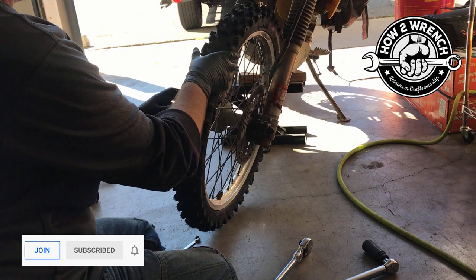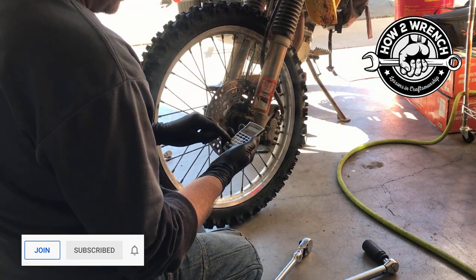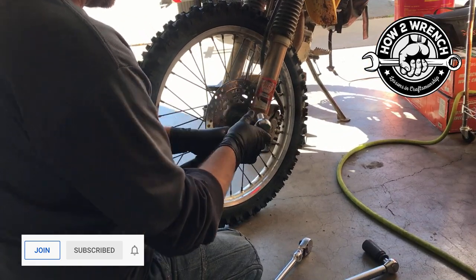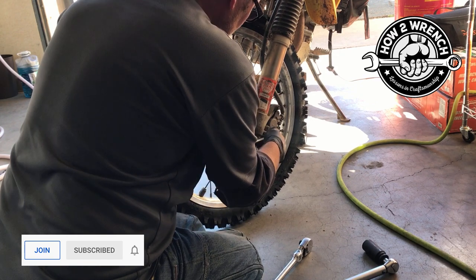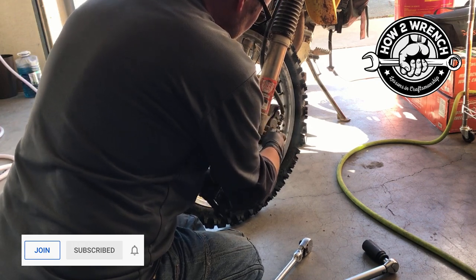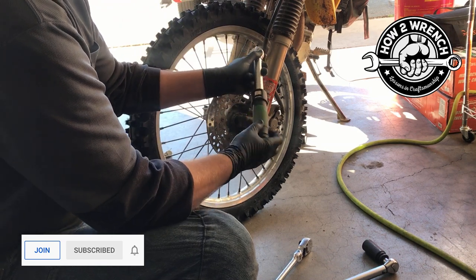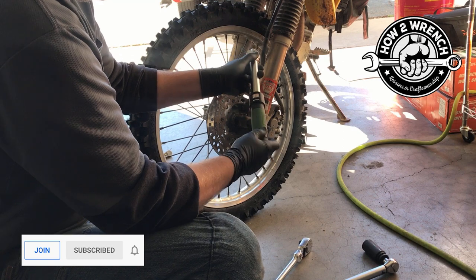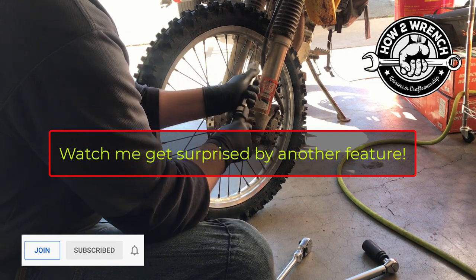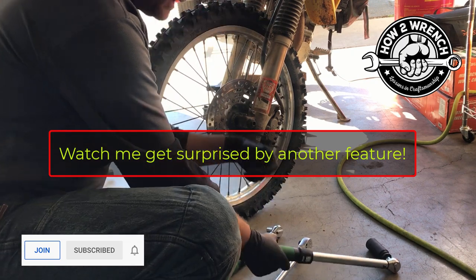After the pinch bolts, it's a good idea on tire changes to check your work and make sure there's no binding. Now for the brake caliper: 12 times 19 equals 228 inch-pounds. Got it set. One more thing about torque wrenches — when you're done, back them down and put them back in their case at the lowest setting. Don't leave them under tension; going beyond that low setting can damage them.